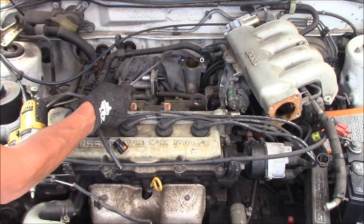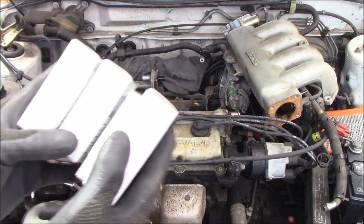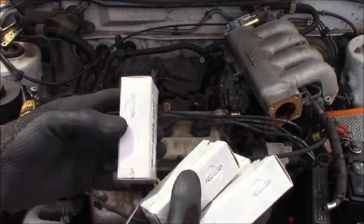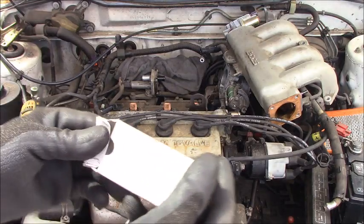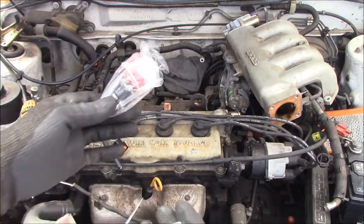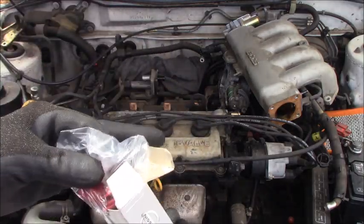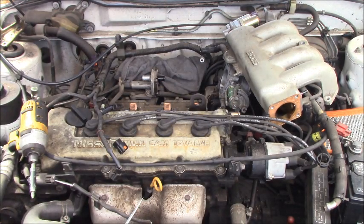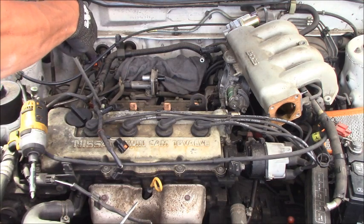Okay, anyway, when you remove the intake manifold, you have to cover the hole like this before you drop something in it, and it seems to be too late. And the fuel injectors, I already have four on hand here, you guys. Yeah, Nissan fuel injectors, Janus parts, something like that. And let's see one in here. You see the one in the car is that color, and the new one is red, okay? But anyway, if it fits, the color doesn't matter. And the fuel injector is dirty, so you have to blow the air to get the dust off like that.